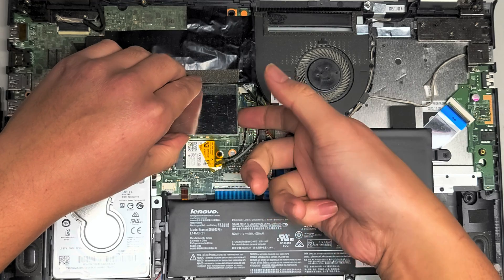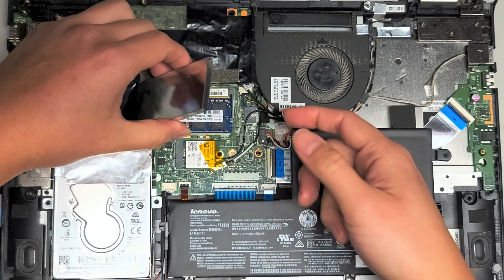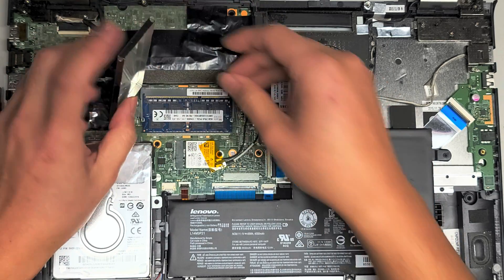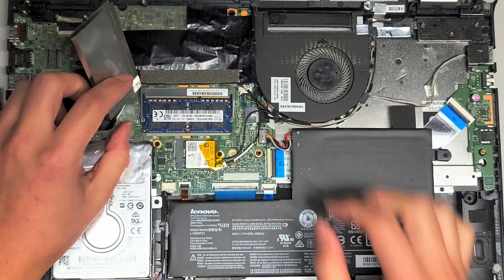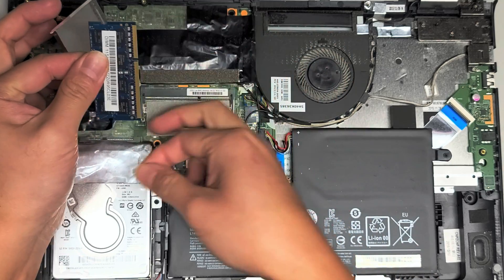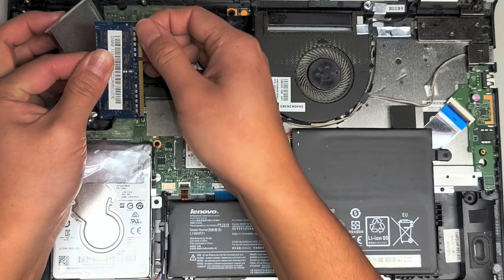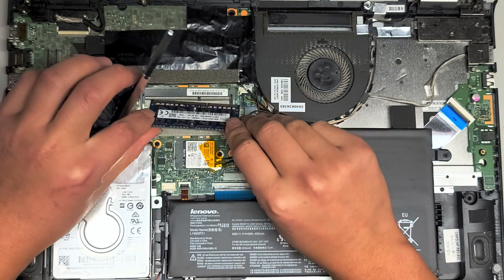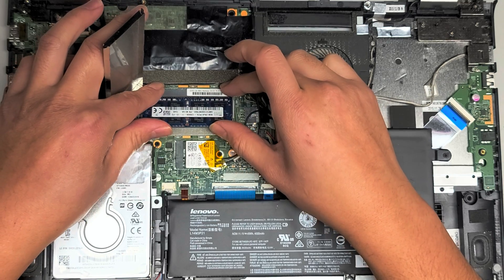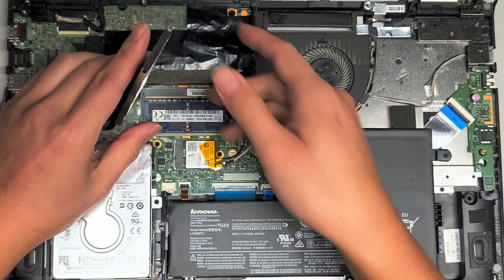Now what I'm going to do is check the RAM. I'm not going to do much disassembly on this because the customer just wanted me to do a quick check. You just pull the cover up like that, then you've got these two tabs — pull them to the side. A lot of times this RAM will get some corrosion on it, so I just wipe it off. You can use rubbing alcohol, but this usually works really well. If it is a RAM issue, make sure that you have yourself grounded to the floor or touching something metal to prevent any static buildup from damaging the internals.